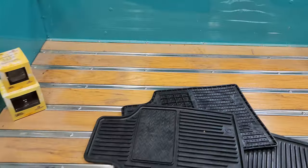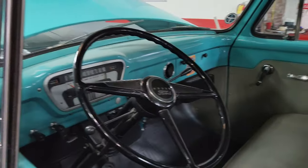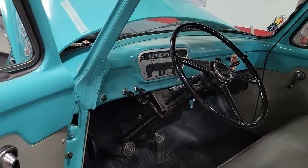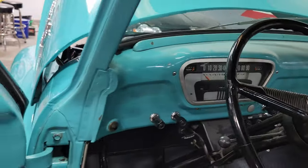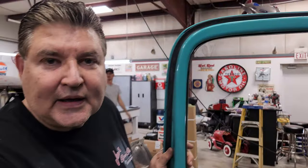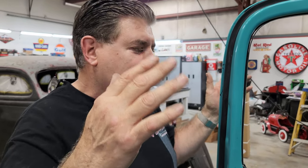Dope color, and the wood back here is super nice. The chrome is pretty cool. Springs were replaced in the front. We repacked the front bearings and serviced it. We rebuilt the steering column and the entire shifter linkage for the transmission. This morning we finished installing the bushings for the column linkage — the metal inserts had been thrown out or lost. It was riding against the rubber grommet, and metal against rubber doesn't last. So the bushing slides in, a little dab of grease, metal against the rod held in with a clevis clip, and bada bing — she's working.